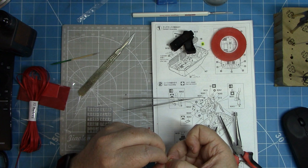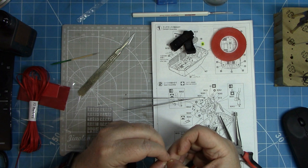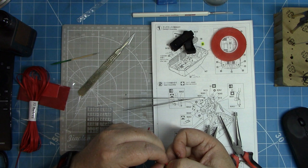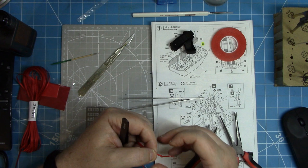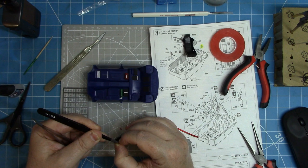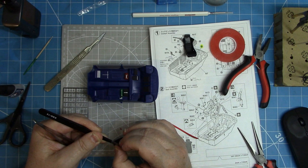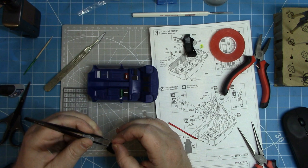So this is definitely a study in perseverance, a little bit of stupidity. I think the best solution would have been to get some better material. I really do in retrospect, but that's not what I did. I persevered, and figured out a couple of different ways to improve how I could put them in as I progressed. Some of those were to trim a little bit off the edge towards the end of the seat belt where I'm cutting the entry point, and either use super glue to seal over the end of it to make sure it doesn't fray as easily, or even use a little bit of fire from a lighter or a candle just to get rid of any fraying.